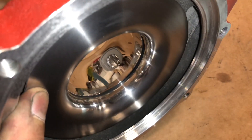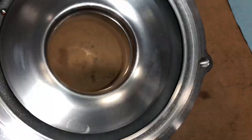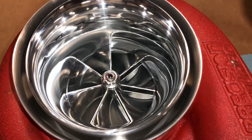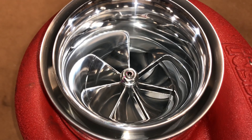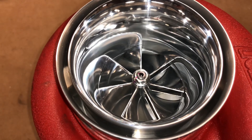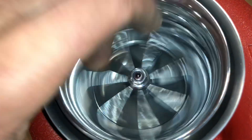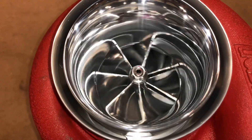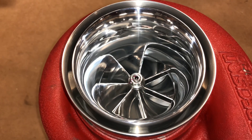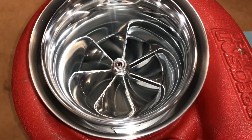This is just where I redid the anti-surge. The most horsepower I had somebody make out of this compressor wheel size was 926 horsepower, but that was before we did the turbine upgrade. The one that made that much power had a 1.06 T3 turbine housing. This one has a 0.82, but the one with the 1.06 just had a GT35R turbine, which is only 62.35 or 62.45 millimeter.